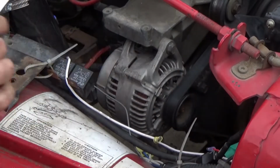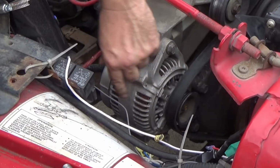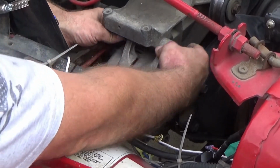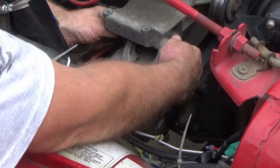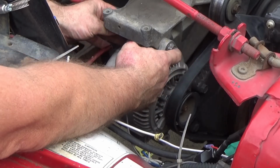Okay, I about got that bolt out, I believe. There he goes. Bolt's out, and watch this. Push the alternator in. You see how easy it moves? Now it's hitting the bracket back here and on the block. You want this loose enough that, like I said, if I push it forward, I've got about a 1/8 inch gap right here, which allows that bolt to move some.